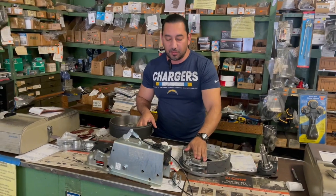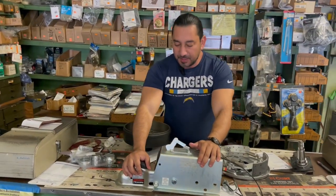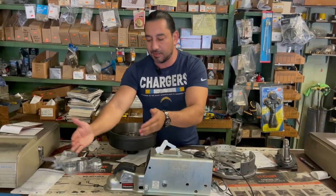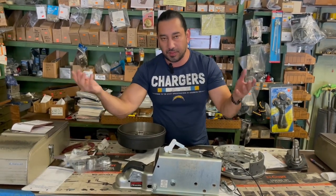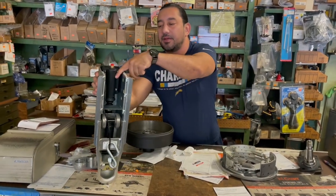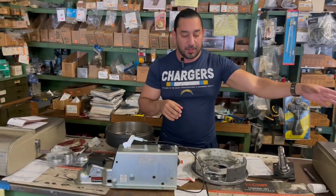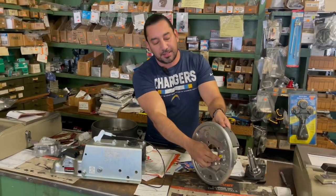The way that these cylinders work is basically this is the brain of the operation. This works off of inertia. This gets bolted or welded onto the trailer side of things, and this connects to the vehicle. If you have a ball — a 2-5/16, 2-inch, whatever it is — you're going to see on the bottom of this a basic master cylinder. When you hook this up, you hook up the brake line and run it all the way down along the trailer, and it connects to this cylinder.